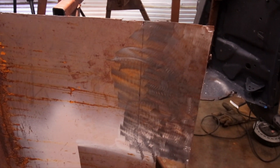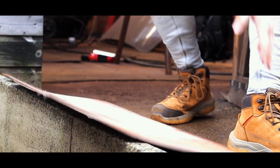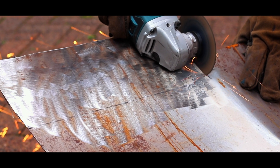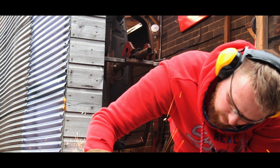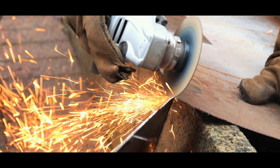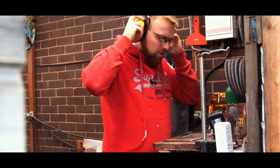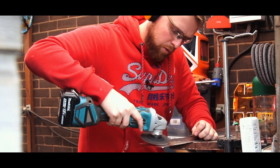For this next repair I'm going to have to make a new piece out of metal. I'll show you what we're going to make — I did it last time by bending it round what was already there. As you can see, down here there should be a piece that carries on and finishes on the floor, so I'm going to cut that out, measure it and knock it into shape. What a lot of people don't appreciate when restoring cars is the amount of time it takes to carry out such a small repair. First you have to measure up, mark it out on a piece of sheet metal, cut it out, clean the metal, try and fit it, adapt it for better fitment, and prep it with weld-through primer — all before you can even begin to think about welding it in place.